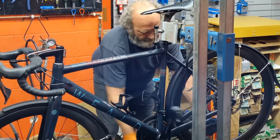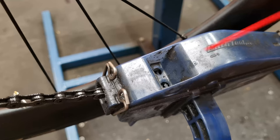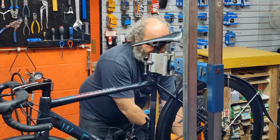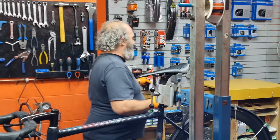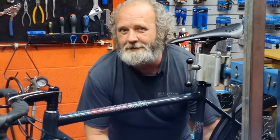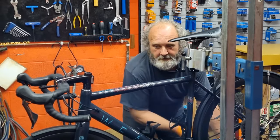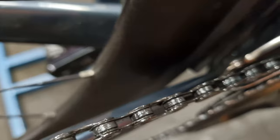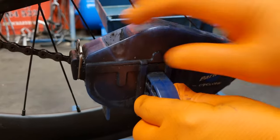What I'm trying to do here is just get enough liquid on the outside of the chain but not actually get it into where all the rollers are - we don't really want that much in there at all. I'll show you afterwards how much I've actually used compared to what the line says. It's such a waste of product whatever you're using in there. I'm going to back-pedal the chain through it maybe 30 or 50 times, just until it looks all nice and wet on the outside.